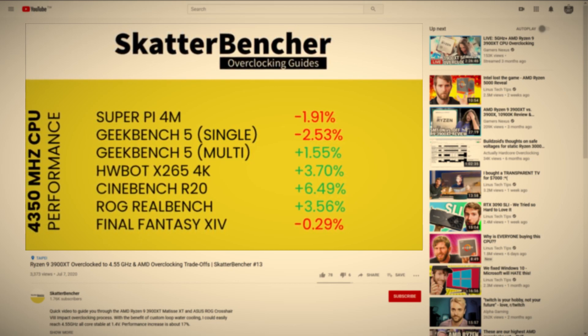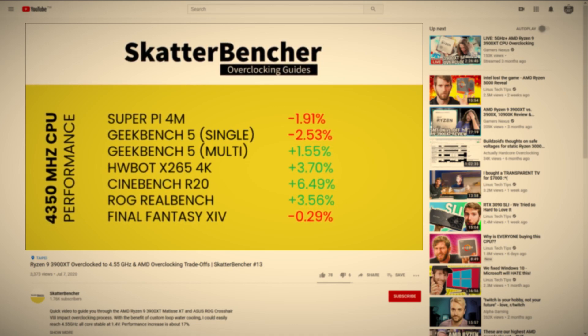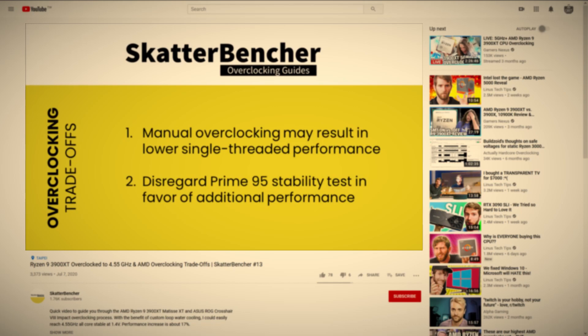When manually overclocking, you lose the benefits of automatic boost frequency, and you can't configure the boost frequencies by specific use case — for example, by core usage or per core. This is the first overclocking trade-off: settle for lower single-threaded performance with higher all-core performance, or the other way around. Another trade-off is that there's no way to configure the system for truly worst-case scenarios like Prime95 Small FFT with AVX. On other platforms you can use an AVX offset ratio, but on AMD you can't. Dynamic OC Switching allows you to dynamically switch between OC Mode and PBO, so you can benefit from those very aggressive frequencies offered by PBO that go well over your manual overclock.